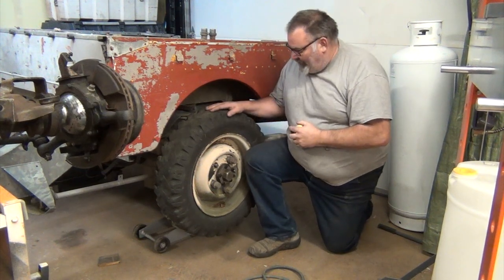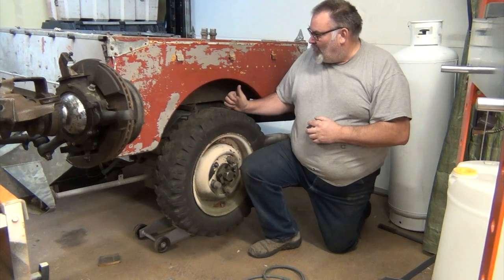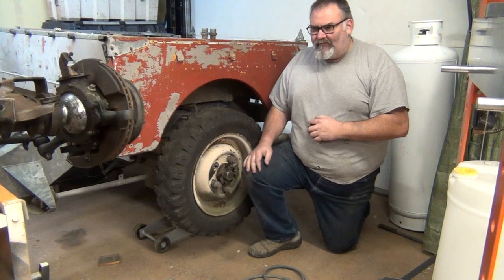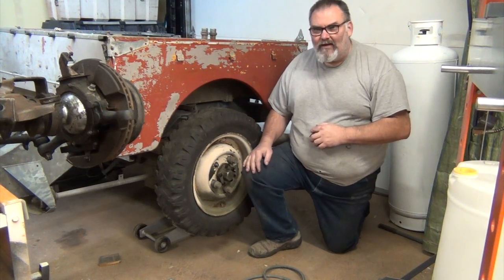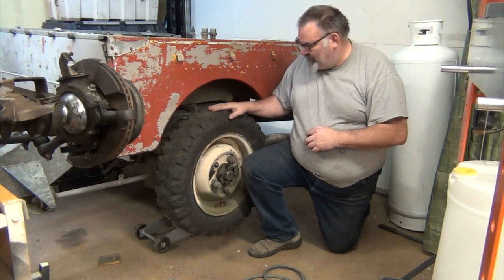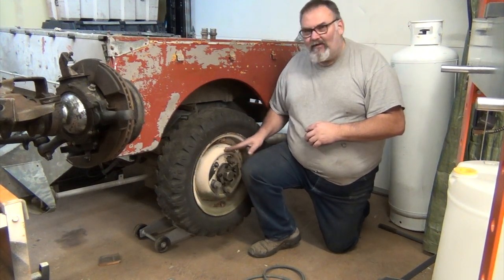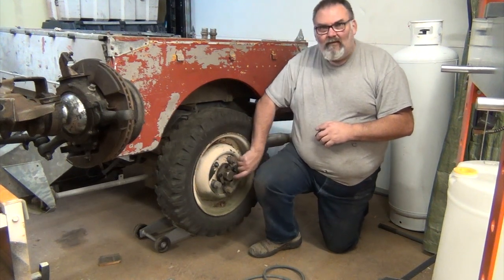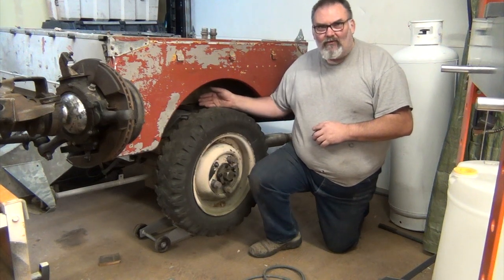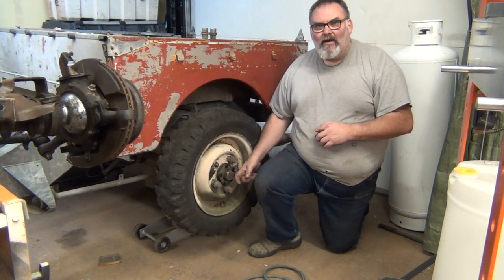So we've got this one on, and it definitely helped out a lot — definitely got a lot closer. We're only about an inch and a half now off the sides, so definitely closer. But I think I'm still stuck — I think I'm still going to end up with eyebrows and a different set of rims than this. The problem is the ends of the axle here are still sticking way out, so even if I get a rim with an offset further in to tuck it under, these axle ends are still protruding.